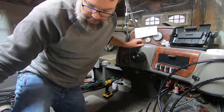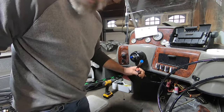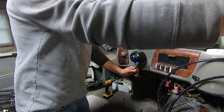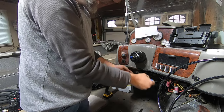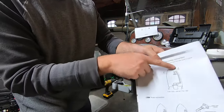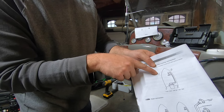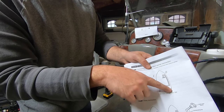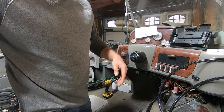So now I'm going to go back under and attach my cables. And I'm going to put blue on the starboard, which is on the right, my right, looking forward. And I'm going to put the red on the port. And I labeled these, front of the boat, blue starboard, red port, because in the back of the boat, you got to reverse it. So on the back, red will be starboard and blue will be port. So get under there and install those.